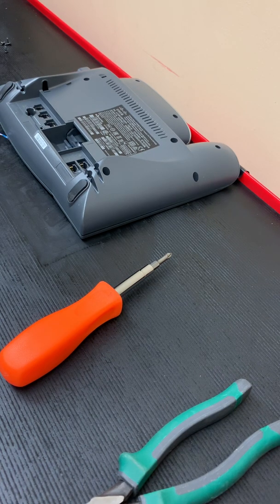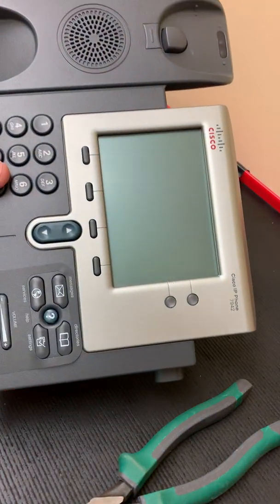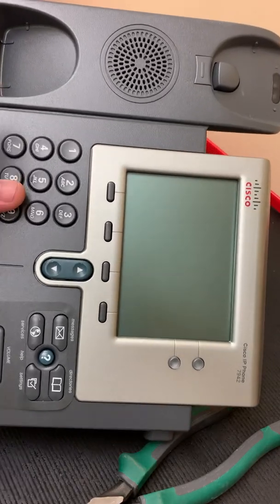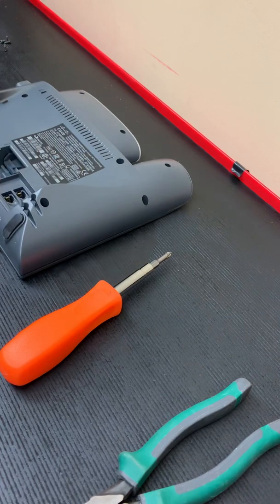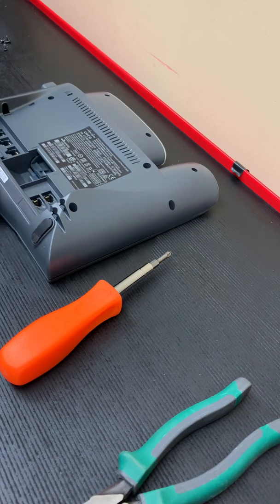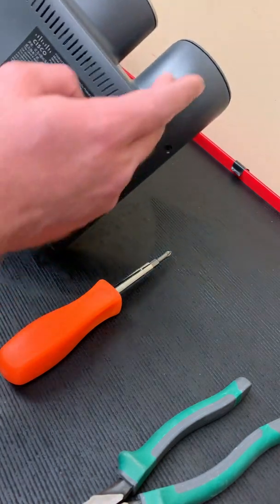There's really no reason to do it that way. What we're going to do is take a regular phone — in this case a Cisco 7942, but any Cisco phone that has a speaker can be utilized for this. We're going to basically disconnect the speaker, extend the speaker wires, and utilize the speaker wires as your tip and ring input into your analog paging amplifier.